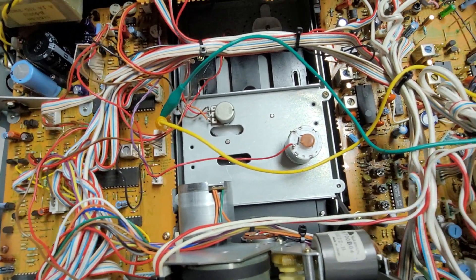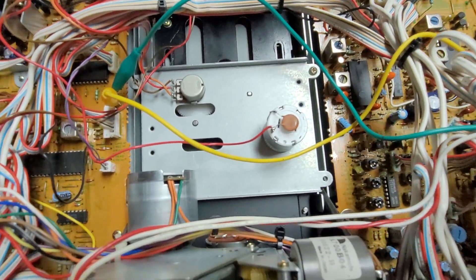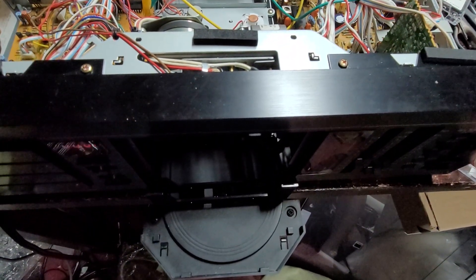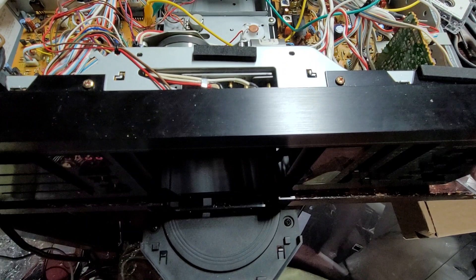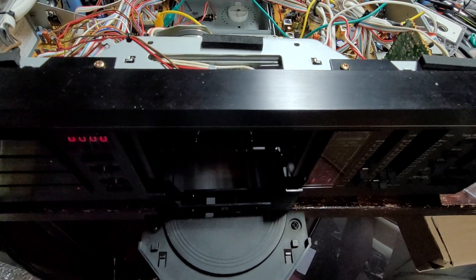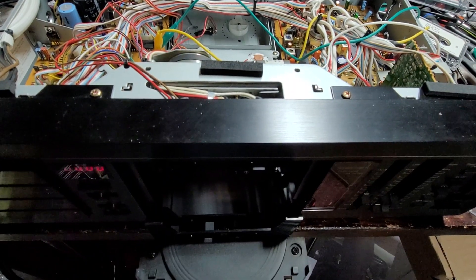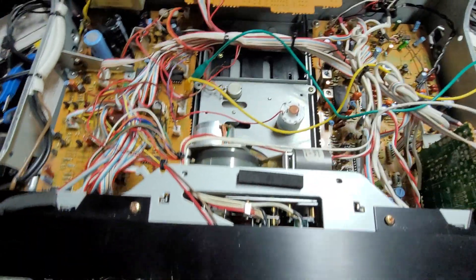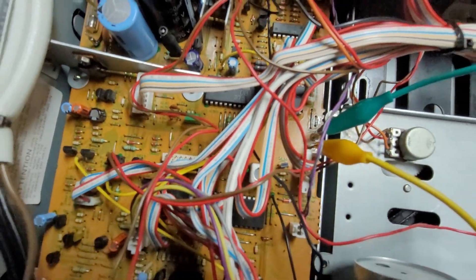I'll push this in and power it up. What you can hear is the motor binding because it's trying to close. If I hit eject, it turns to the B side. If I go to the B side and try to hit the reverse button, it doesn't want to stay — it doesn't want to quite stay in. And of course the binding is not a good thing.